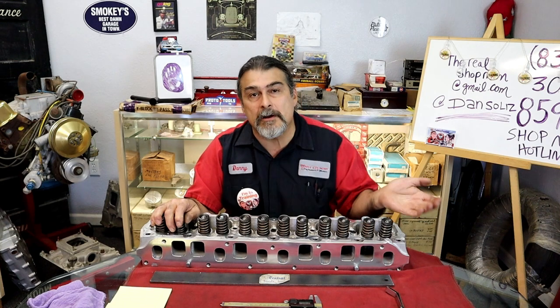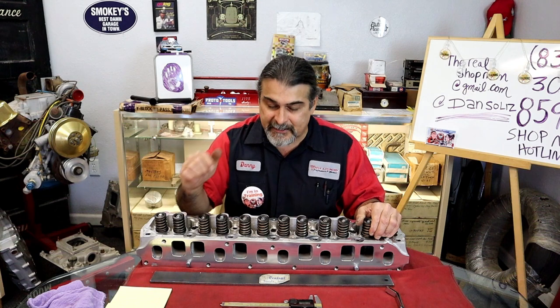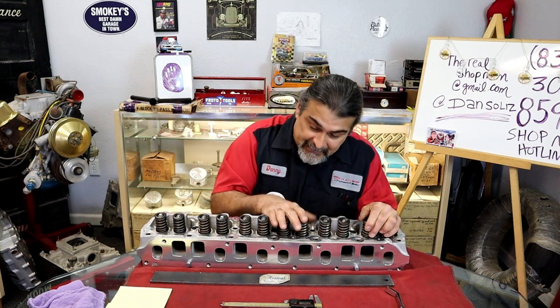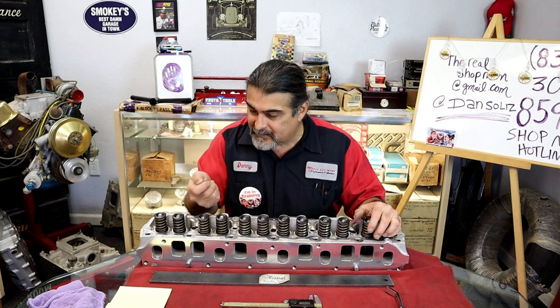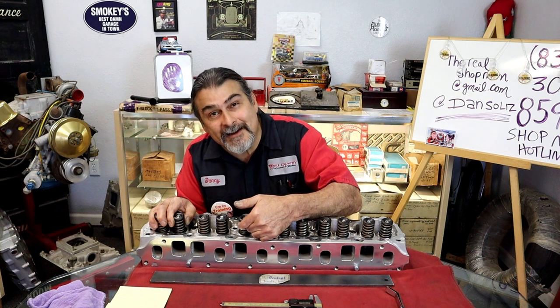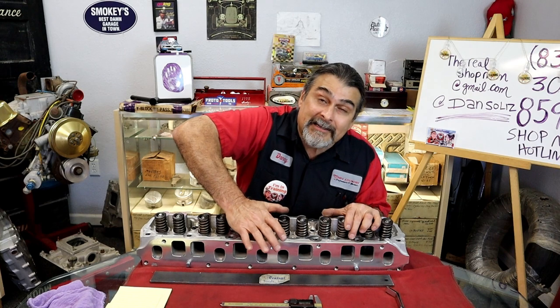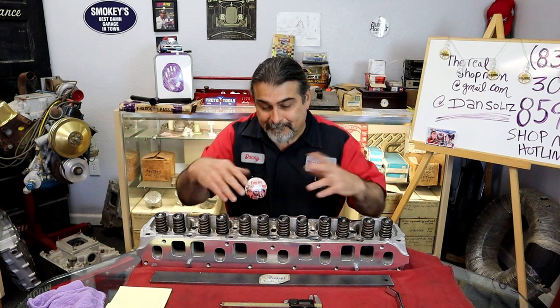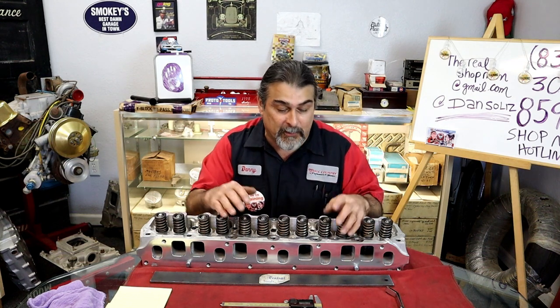The missing would come and go. We spent 2 days on the run stand, chasing carburetors, pulling valve covers off, looking at everything. The more we scrutinized, something's wrong. Golly, checking the valves again. And finally, it's like, would you believe that? Spring broken, just twisted right off the top. Still had tension, but it would miss. Weirdest thing in the world, chasing my butt because of a broken spring.